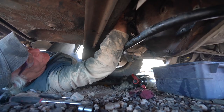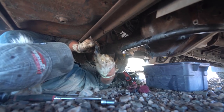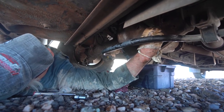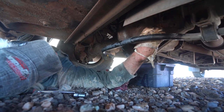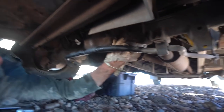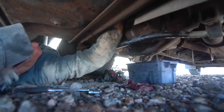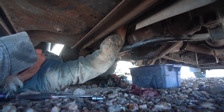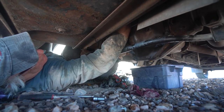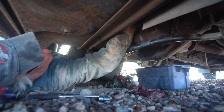This tag has all the information for that rear end. He said he had a gasket but the parts guy gave the wrong one — if he'd had that tag, he probably would have gotten the right one. The bus has got a little heavier chassis on it. Everybody says all the one-tons got the same differential, but that's not true. At the top you want it to seal, but you don't have to really worry about that because the oil never goes up that high — it splashes around. If you had no gasket in there, you'd know real quick because that gear oil would go everywhere.